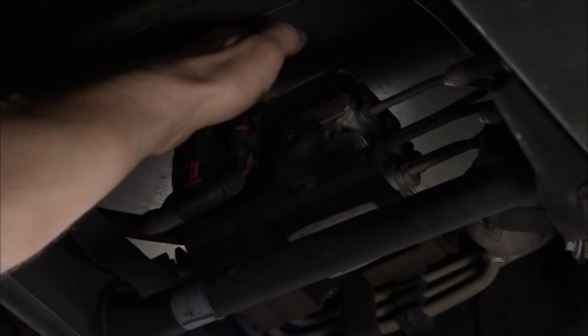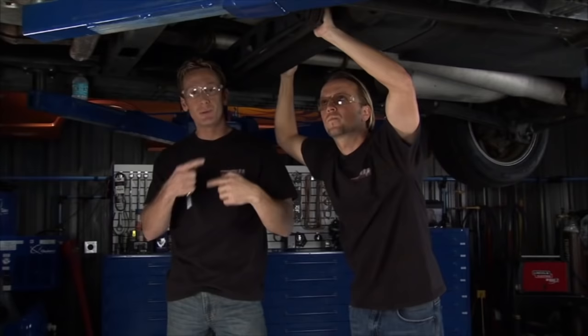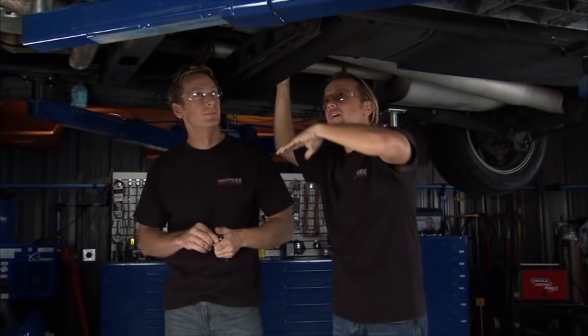What's going on is this ABS control box — this module — has gone bad. If you let the ABS module go bad, the ABS pump will continue to run non-stop and it'll kill the battery. Not only will the pump wear out, but your battery will die on you. The problem is that when you shut everything down, you can't hear this pump on this particular vehicle, so the battery dies and you're thinking, what was it? You've got to diagnose the problem.